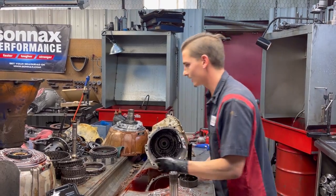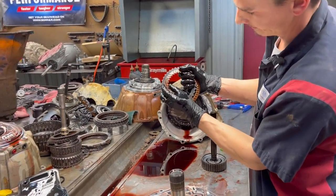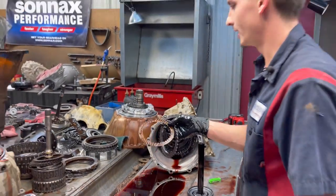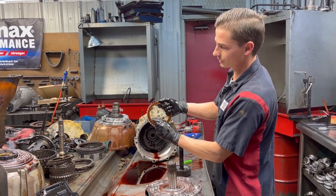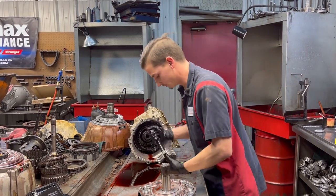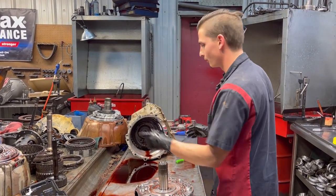And your Power Glide clutch is about easy 1/8 inch wider than this clutch. I wish I had one. We had one out earlier. I don't know what we did with it, but it makes this smaller here, which makes the surface area of the clutch bigger and good to go. It just gets rid of that problem that they're having. So that is your 4-5-6 clutch hub.